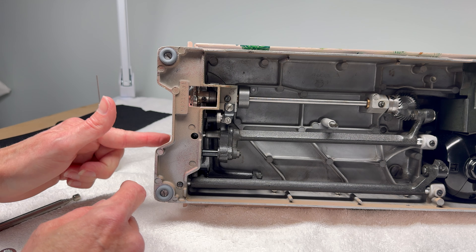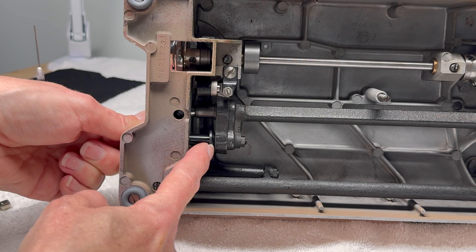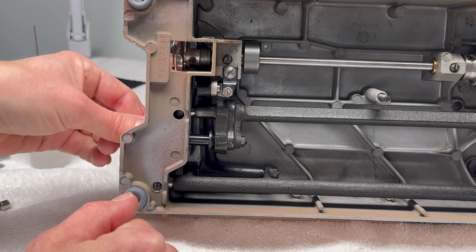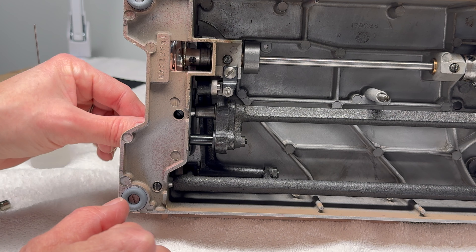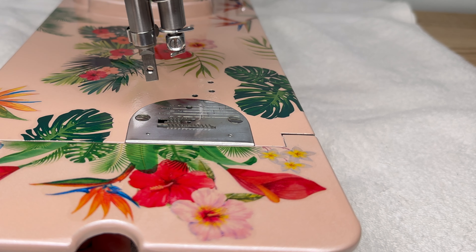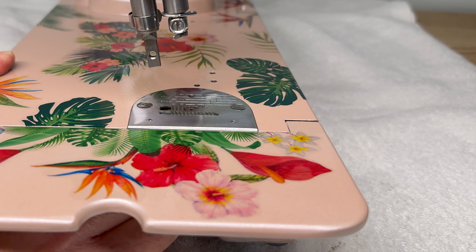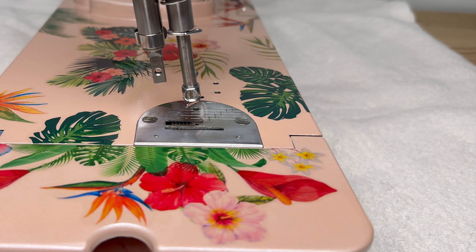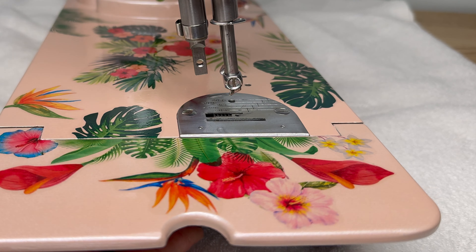Once that's tight, I should be able to turn the knob on the end. This is how we are lowering the feed dogs — it will go to a certain point and they'll be all the way down. When I'm ready to raise them back up, I turn the knob. Here on the top side now that I've put it back together: the feed dogs go up and down and the needle plate moves back and forth. Turning the knob counterclockwise — there they go, they've disappeared. I can turn the hand wheel and they don't come up out of the needle plate. Turning the knob back clockwise all the way — there they are again.